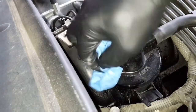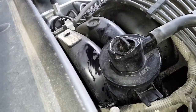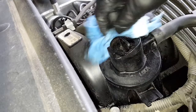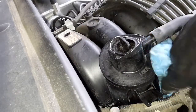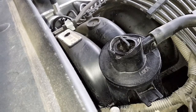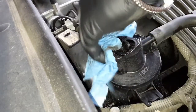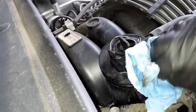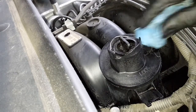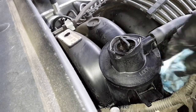But yeah, it's looking like this valve, even though I didn't get any check engine lights or anything, is not doing its job properly, because as you saw in the spark plug change, all types of oily gases were remaining and showing up all over my spark plugs. So this is probably the most important thing I'm doing right now as far as repairs for today.